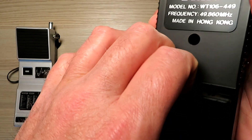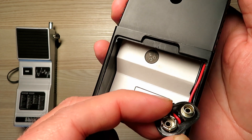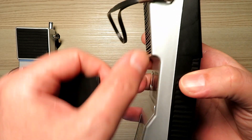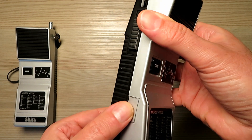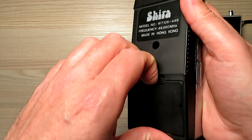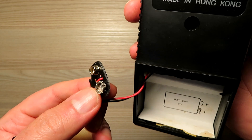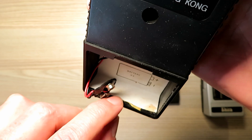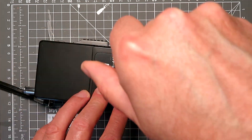It was nice to see that both the battery clips were there and the backs were there, and on initial inspection the battery connectors looked to be in fairly good nick. The batteries normally show signs of acid leakage down the sides and these looked fairly new. However, as you can see, where the 9-volt battery had sat in the radio there was some noticeable acidic staining on the paper.